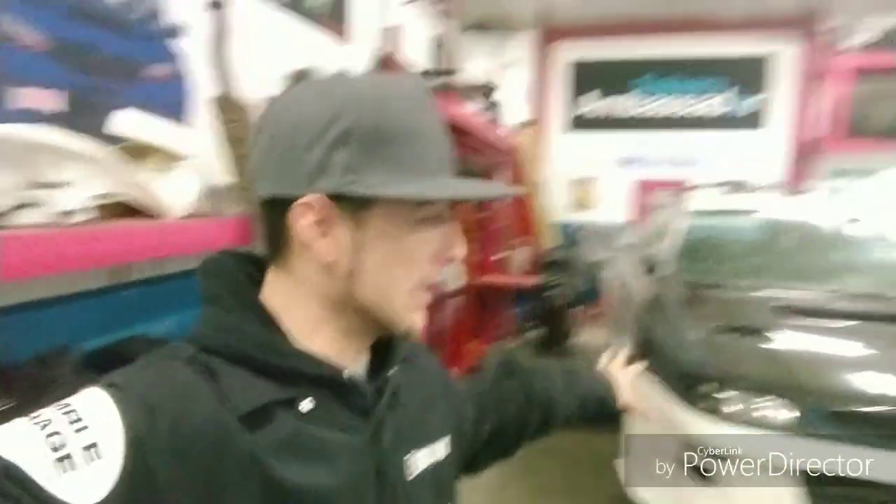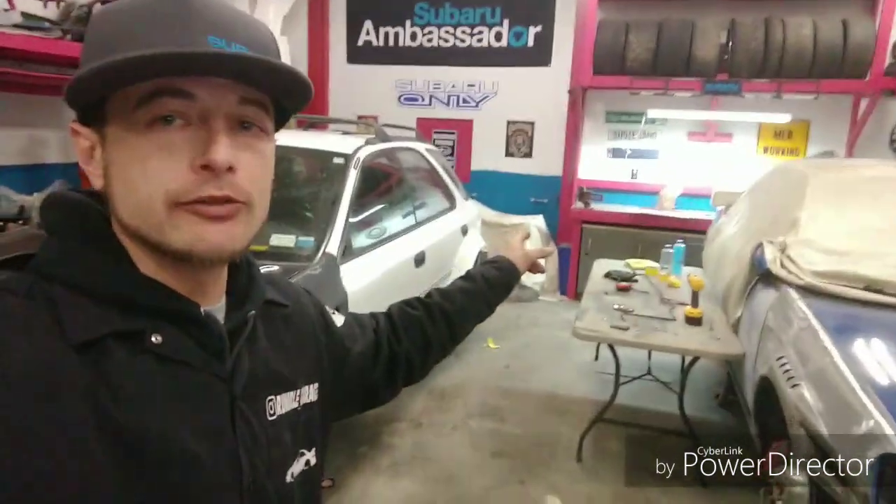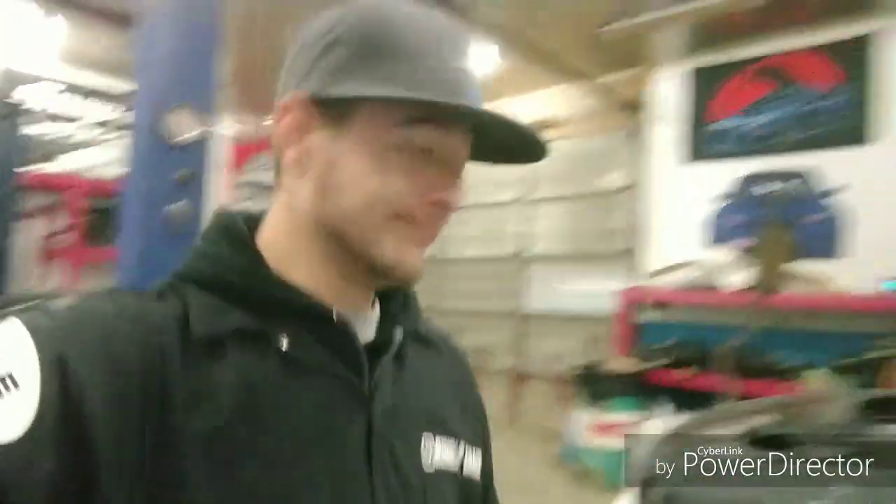What's going on subscribers — today we're working on the wide body wagon, basically just doing some buttoning up. We're trying to get the kit fit exactly where it's got to go. Before we can do that, I need to add structure. I had a couple footnotes on the side skirts to bring them up to get the body lines I'm looking for. I'm stripping down the kit to reinforce the side skirts and add some bracketry underneath, including custom work on the brackets for the body mounts. I'm gonna put a jack pad on there so you can throw the jack underneath without destroying the side skirts.